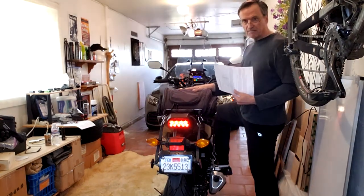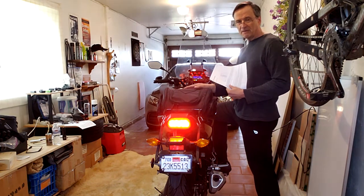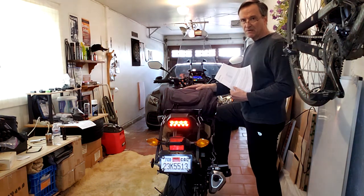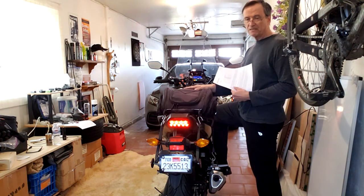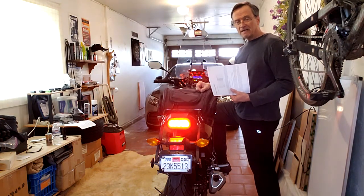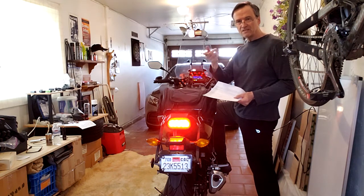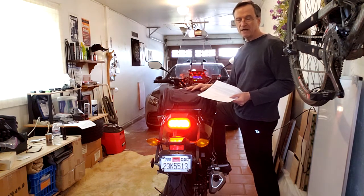Here's what I mean. Right now if I were to apply the brakes, you'll see a flash — there you go, I'm coming to a stop. Now I'll release the brakes, go a few more seconds, and stop one more time — no flash again. The default is 12 seconds between those flashes, so as not to annoy the drivers behind you.